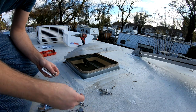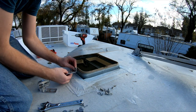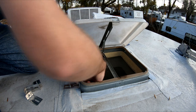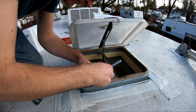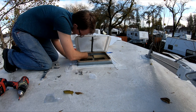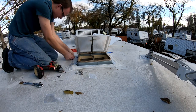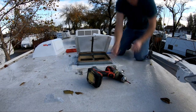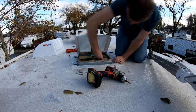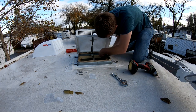Your next step is to put your L brackets on there. You're going to have a carriage bolt that goes up through the bottom of these L brackets, and then there will be a Phillips head bolt with a washer, a lock washer, and a nut on the other side. For this it's a lot easier to open up your vents all the way so you have extra room to get your hands in there and put your nuts on and tighten everything up. These don't need to be super tight, but you obviously want to get them as tight as you can so the thing doesn't fall off. This is the whole structure that holds the new Max Air vent cover to the vent of the RV — it holds through the side of the vent cover, so it's not mounted to the roof and you don't need to put any holes in the roof.